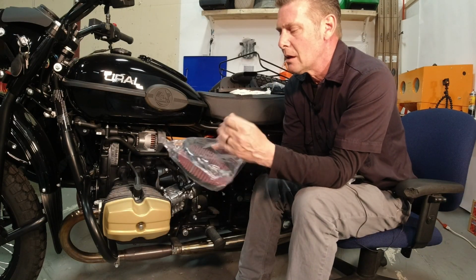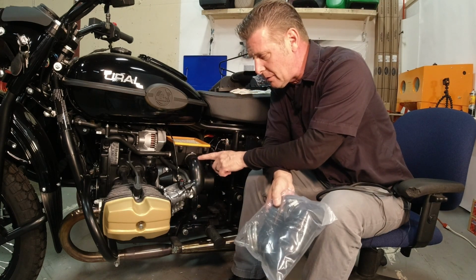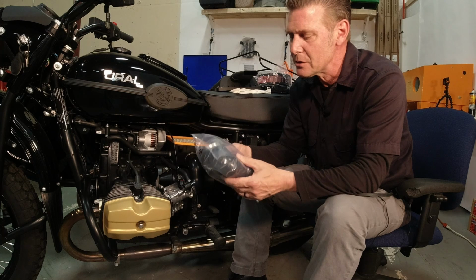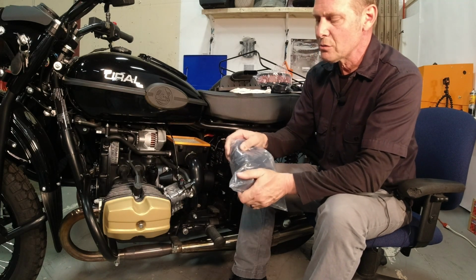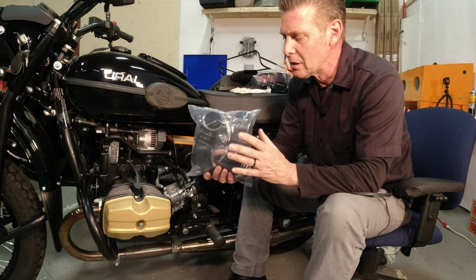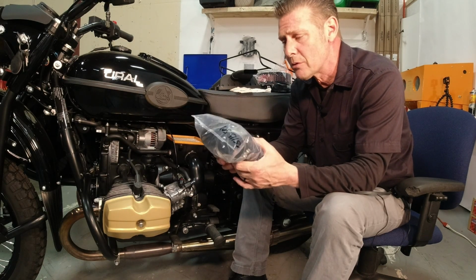So if you have one of the older bikes and you need an air filter, we have these, as well as your dealer can get this, or probably has it again on the shelf in stock. The old branch pipes were a three-piece design. You had the two rubber pieces connected to a steel intermediate pipe. These came out many years ago. It was actually a fix for the older carburetors for misalignment issues with the airbox, and it was a little bit more forgiving than the three-piece design. So we had these made, and we still sell them as a set. You get 4 worm drive clamps and the one-piece branch pipe for the older carbureted bikes. And these are either available on the website currently, or they will be very soon.